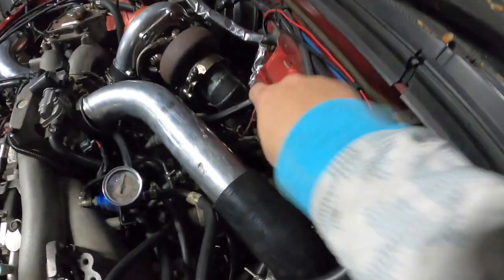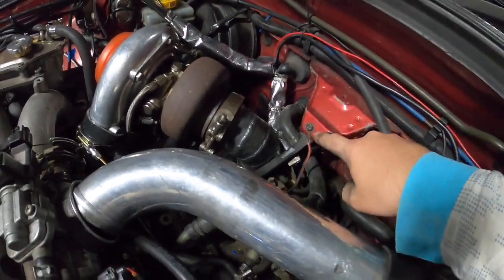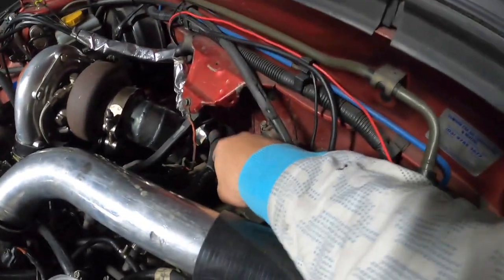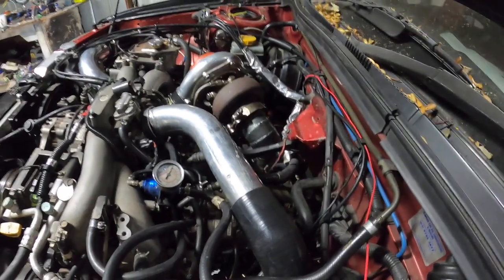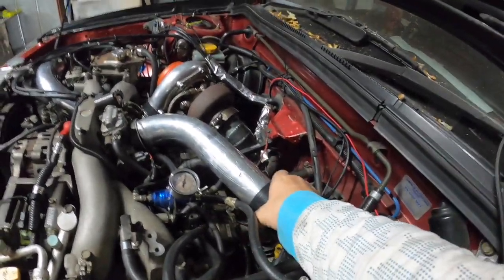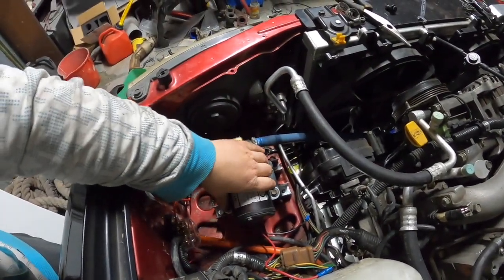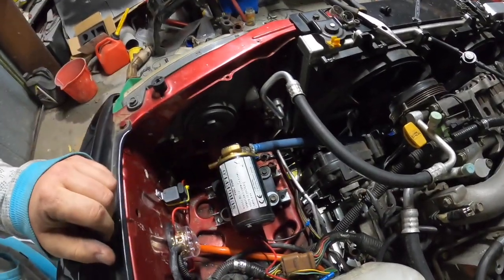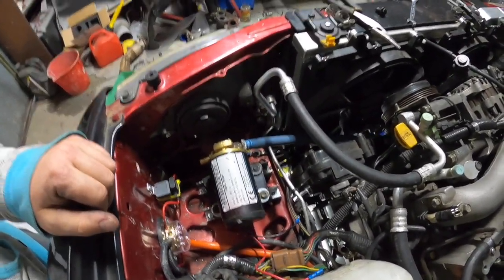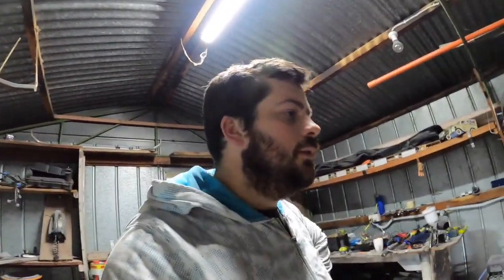If you didn't realise, I also had fitted the heater hose as well, so that's routed around, so I'll heat wrap that and put one of those sleeves on there. It comes around and in there. It's got no clamps on it yet. Did that last night after I turned off the GoPro. So just need to put a clamp on here, get the coupler for that, and now I need to rubber mount this, which is solid mounted at the moment, so it would resonate through everything. So yeah, I am pretty happy with that. I'd call that a win for now.